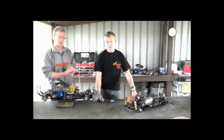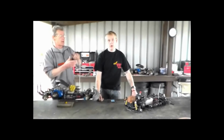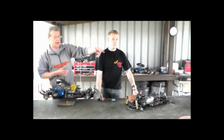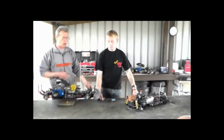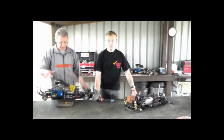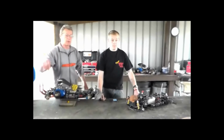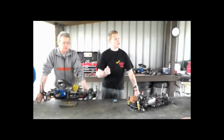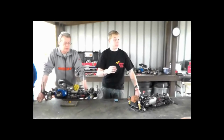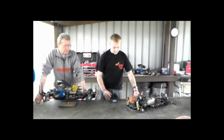Yeah, absolutely perfect. At the Euros championships here in 2000, every car was rolling on the corner. Every car had the same problem. We ended up putting a worn A on the front with C's everywhere else, and the A just burnt out, and there's no grip roll at all. But that A still gave that little bit of grip on the smaller corners, so you had the steering. And as I said, that's why you can also play with Ackerman angles and everything like that.